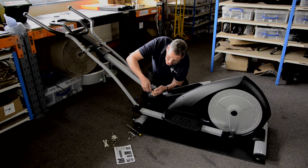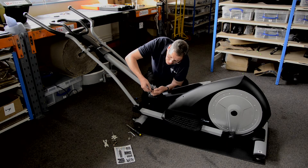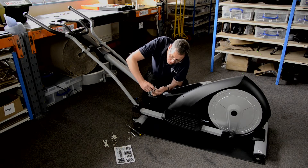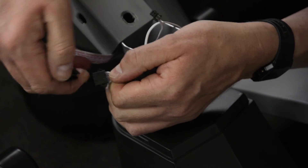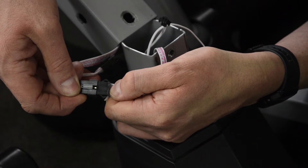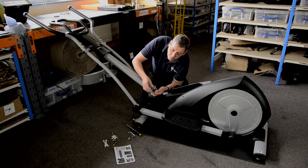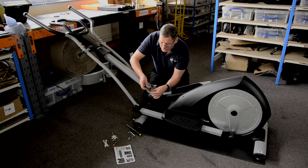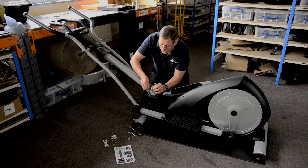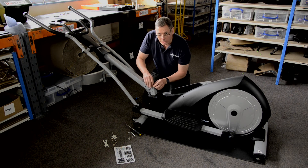And I can see that where I made the mistake was I actually connected it round the wrong way. I didn't get the latch at the top. The latch actually clicks over the top of this little plastic tang, which is on the top of the socket. So click, nice fit. That was the problem. So I think if I put my other connectors back together and reassemble the machine, I think that will work just fine.